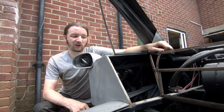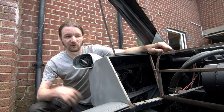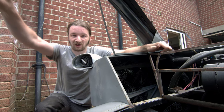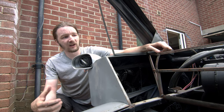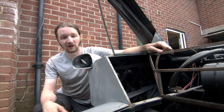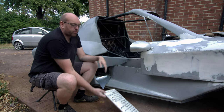We've just reviewed the footage and it looks like we've saved about 6 to 12dB depending on where you hit the panel, compared to the untreated side — a pretty big improvement. It's not super scientific; our heads are up in the car and it's all a bit different. But hopefully you'll have heard how different the timbre is — it's a lot lower and a lot nicer, so working on it and driving it around will be that much more pleasant.